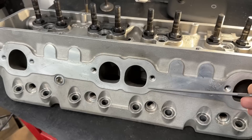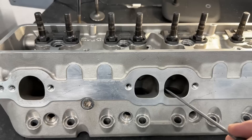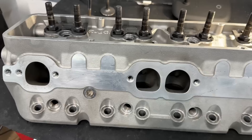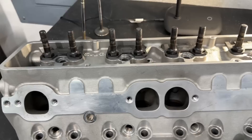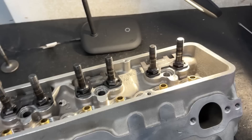Here are the exhaust ports — they're a D-shaped design. Even though they're D-shaped like Brodix's, the Brodix ones are probably raised up 100 to 200 thousandths more than this. These D-shaped ports are also smaller than the Brodix ones. So comparing exit area to the AFR and Brodix, the exit area on this is actually smaller — which in some cases may help if you're running smaller tube headers, though why you'd buy this head and use small headers is beyond me.